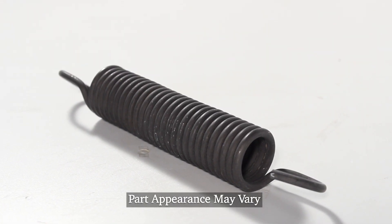Now, to do this repair, we will be working near some electrical circuits, so the first thing we need to do is to disconnect power to the washer — either pull it far enough forward that we can unplug it, or locate the electrical panel and turn off the appropriate breaker or remove the appropriate fuse.